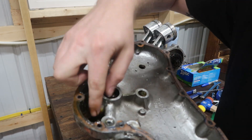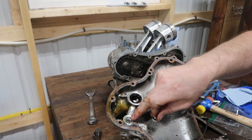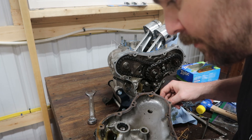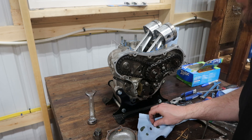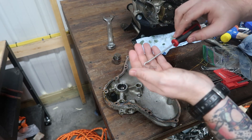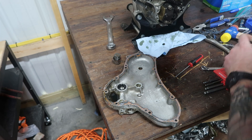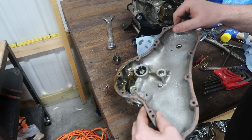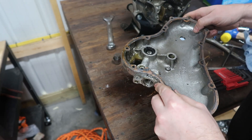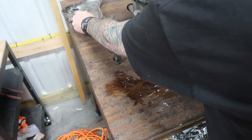Inside on the timing cover, this little ball bearing right here is the one that sits against the oil pump, with the spring to prevent wet sumping. These are things I definitely do not need to lose. The spring came out with zero resistance, so we'll put the ball bearing and spring into a bag. This also has to be cleaned, and I'll probably replace the seal here too while I'm doing all this other work — new gasket, clean it up, and polish the other side.